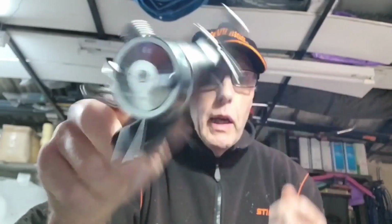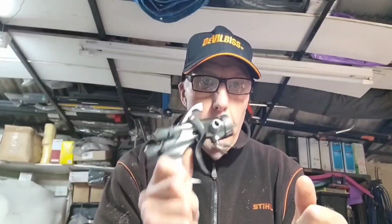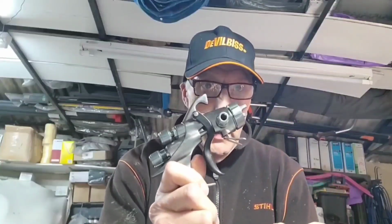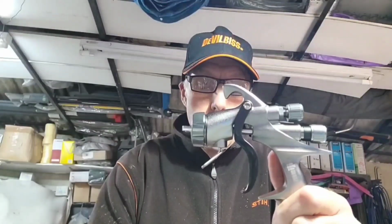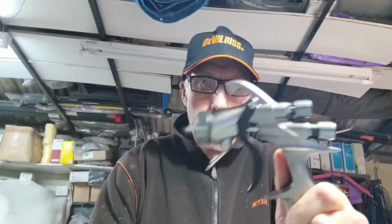I'll try and remember to put a link in the video. Actually, it's one video I've done on YouTube with this as a clear coat gun, and it's an absolute little cannon. Works really well for clear coat. So if you want a super fast clear coat gun, this is the one to go for. So what I'm saying to you is water-based base coat, bit of solvent base coat, really fast clear coat gun, I would recommend you go for the WB.